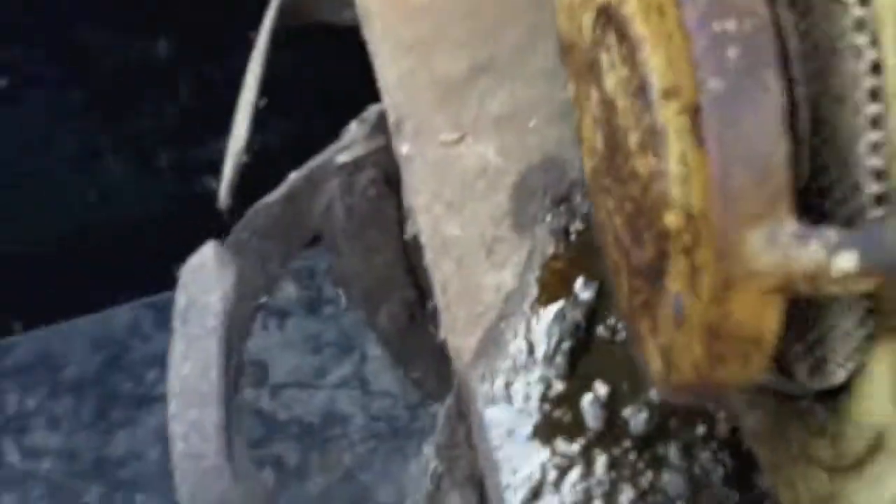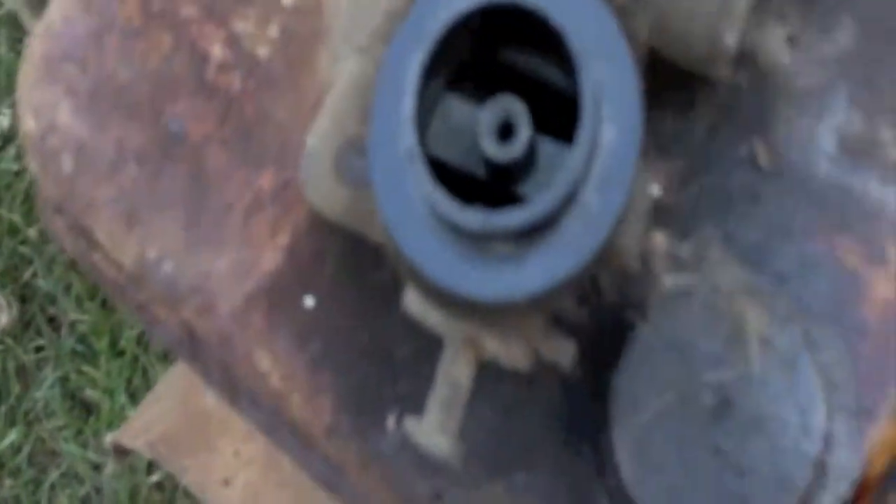So we take it off here — we're going to take this cover off. It's leaking oil because it was leaking on the front, so we'll take a look at it. We got the cover off now, pretty oily. We blew it out with the compressor, still got to get some webs out of there. It was getting some spark, so it might be enough to fire it, but we got to sand stuff down. The governor doesn't move too good. Looks like some old gas, so we're going to get some carburetor cleaner and really clean the carb up. We'll get it cleaned up and show you the next step.